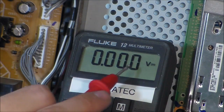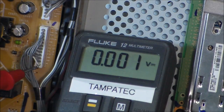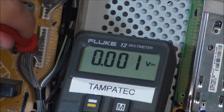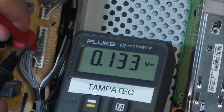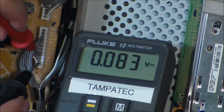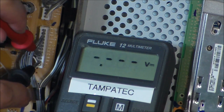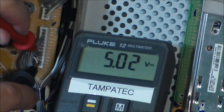I got my meter on DC mode, which is a V with a straight line. Four pins up - this is standby 5 volts. Put your red probe right there and put your negative probe where it says ground, right there - it says GRD, that's ground. And you're getting 5.0 DC volts, which is perfect and it's steady.